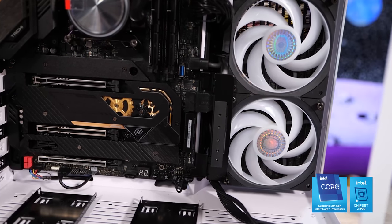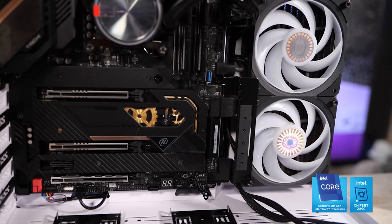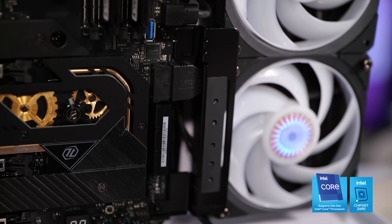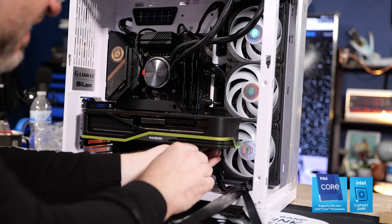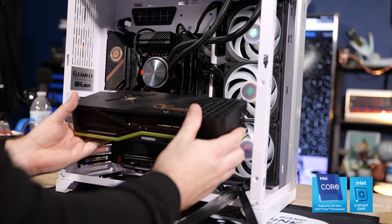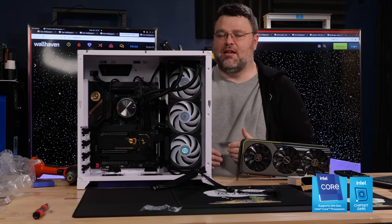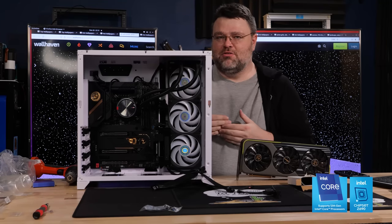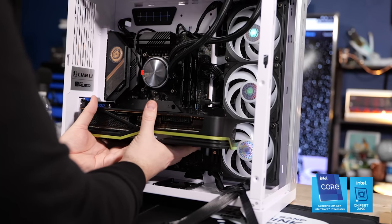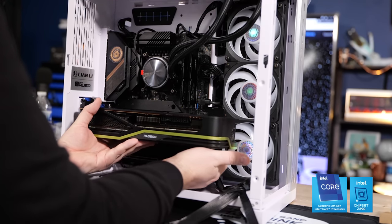Check out the bracket. Yes, the bracket clears the heatsink and fans of our AIO, and it clears our right angle USB 3 connection, which was difficult to wedge in there because you pretty much have to plug the USB in and then angle in the bottom fan. Otherwise, the cable is a little bit too bunched because the cable is sitting inside the cavity where the fan is. But this is going to be a great thing to hold our VGA card. This is awesome.